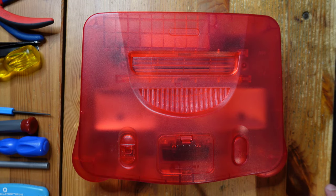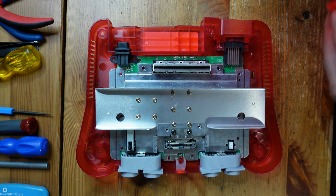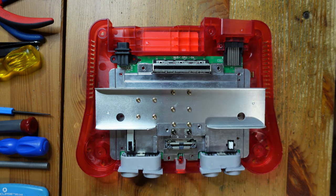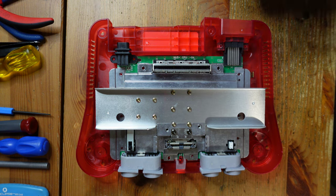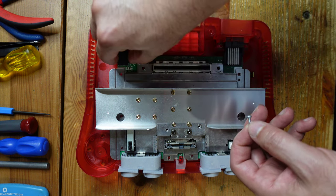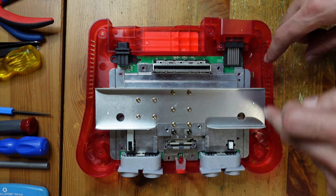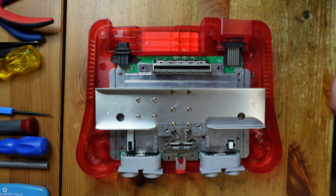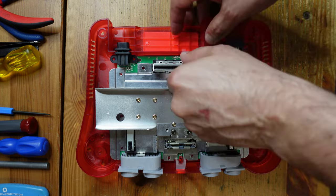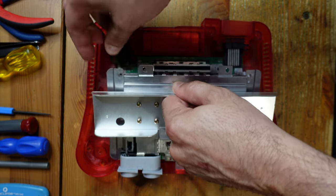Taking apart the Nintendo 64 is pretty straightforward. You start with a game bit screwdriver on the bottom and just remove the six screws there. Then I usually just remove the top lid and take the memory pack along with it. At that point the console looks like this, and you're going to have a couple of different screw types: these really long ones that go near the cartridge slot, silver ones that go on the power jack and on the AV multi-out, standard Phillips screws lined around the periphery — about five or so — and then these really small thin ones where the memory pack goes into place. Once all of those are removed, the console should be free and we're going to start from the back and just lift up the RF shielding like so.